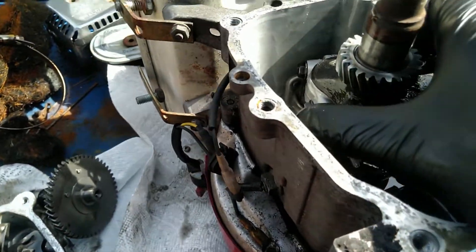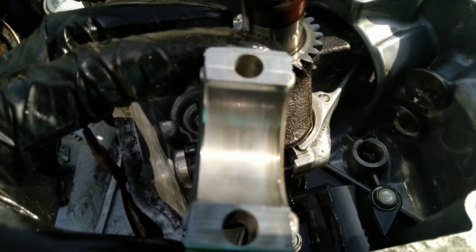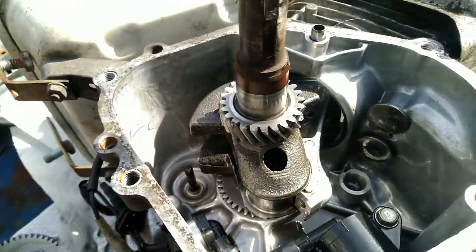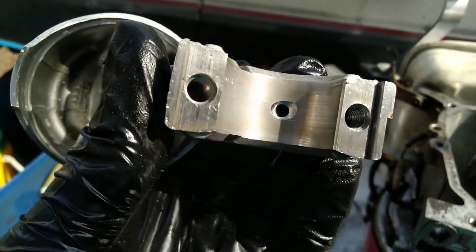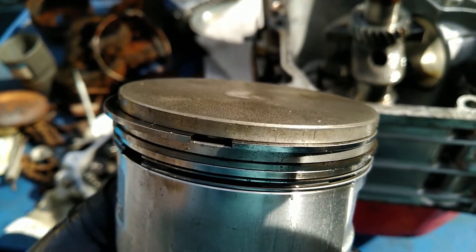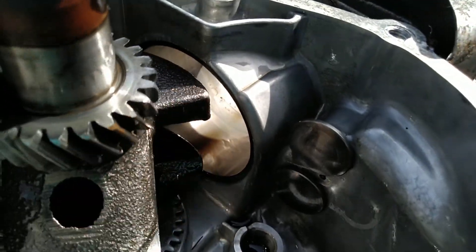Let's pop the rod bolts out and pop the piston out. Look at that — it's like still perfect. How is that even possible? I've been running this thing at like 6,000 rpm and that's still mint. Let's get the piston and crank out and have a look. This thing is in spectacular shape given what it's been through — no scoring, only tiny stuff the camera can't really pick up. The rings are still okay, the crank journal is still totally fine. It's got some light little scratches on it but nothing major at all.